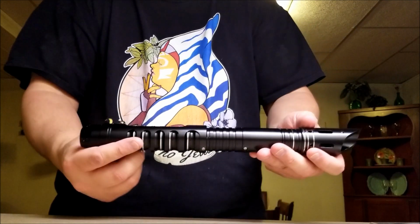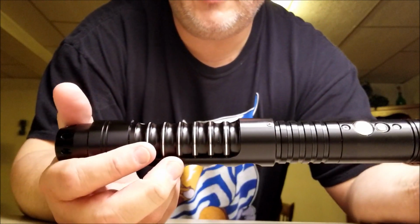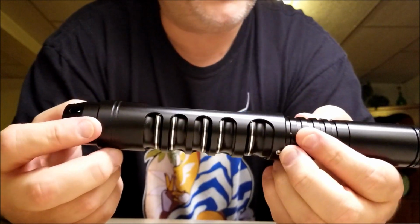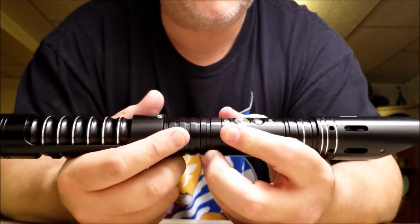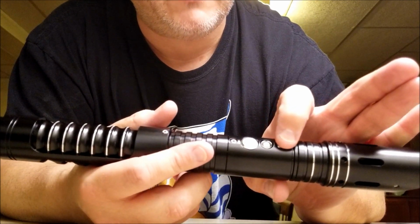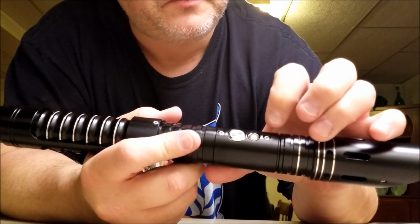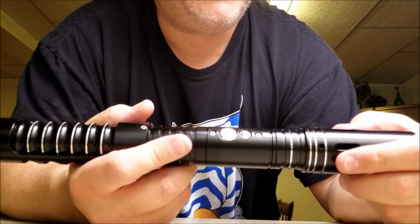Well, anyway, so that pretty much does it. So that's how you install these, more or less, regardless of how this all turned out. I'm not sure if I have this on the way I want it, but yeah, that's how you install these things. So the important thing to remember is once you take everything apart, to get that chassis out, you have to remove these screws, and then you have to actually push in to the screw area to get these switches to lower so you can actually take them out.